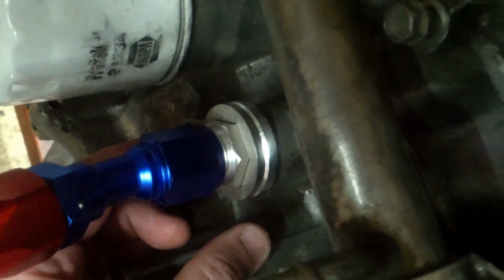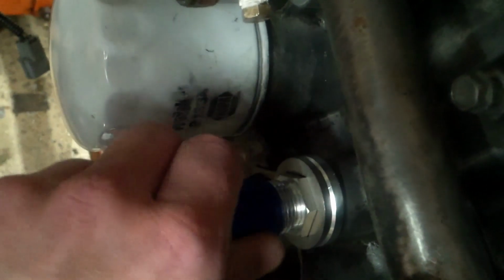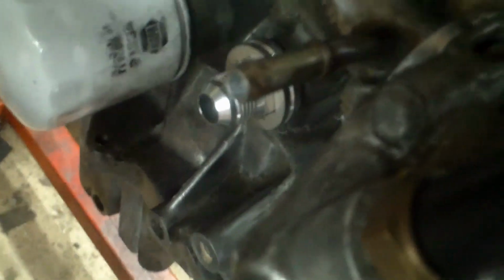The black box, as it's known on the D series, we had that delete. That is from JB Tune. That was $25 also. It's actually really neat. Underneath in this oil pan right here, it is baffled, so there won't be crazy oil coming back up this journal. This journal on this side, if you can see it, that one's not. And this one has a tang and there's a bolt holding it down. So I got a catch can for that, which I will show you.